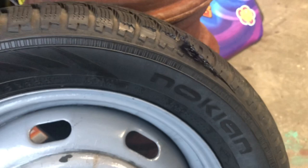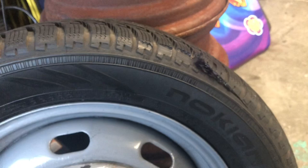This is a 175-65, so it's slightly wider and a little shorter. Let's go around the other side and I'll show you what that tire looks like on the car. That is the 175-65. As you can tell, around my hand up there, I've got room — it's actually a very nice fit. Unlike the stock size tire, which I cannot even get my finger in there; it's tight. It really made turning quite a challenge trying to come home with that spare tire on the car.